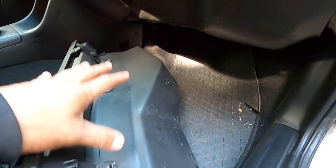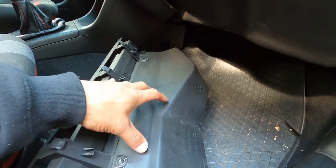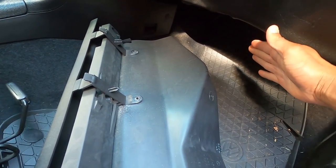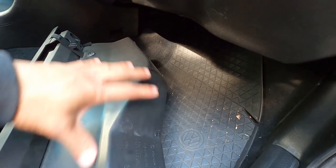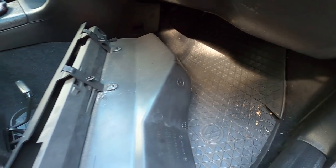Funny story — the day I bought my car, the guy was trying to open the glove box and he snapped it off and said, 'Here's 50 bucks back.' So I paid $1,700 instead of $1,750 because the guy snapped my handle literally in front of me. Now, be very careful if you ever buy one of these for your US spec car. To my knowledge, every US spec Mark 3 has AC, but over in Europe a ton of Mark 3s don't. So if you're buying one of these boxes, make sure they specify it's for an AC car — this portion here is much smaller on the non-AC ones. It won't fit your car properly.